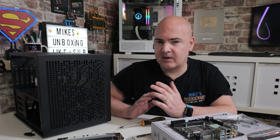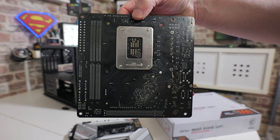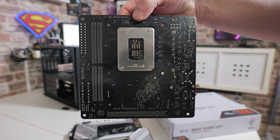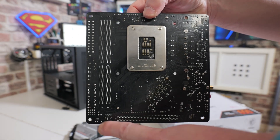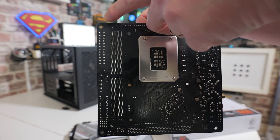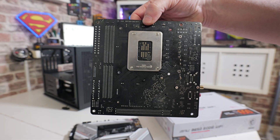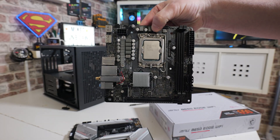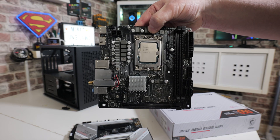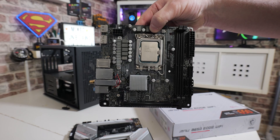The last one is ITX, and this one is really straightforward — pretty much every ITX motherboard comes with the same configuration: four pins, two at the top and two at the bottom. Generally if you buy an ITX case, they'll be laid out in exactly the right places. Where it does get a little more tricky is if you've got an ATX case or a micro ATX case but you're installing an ITX motherboard — you're definitely going to have to move some pillars around or at least double check them.